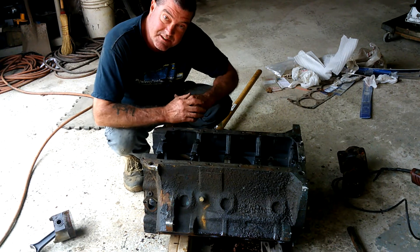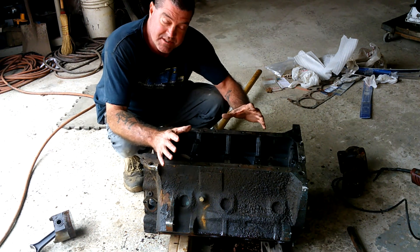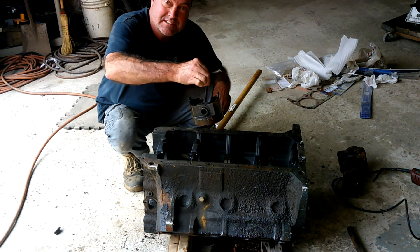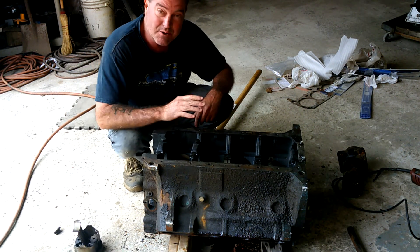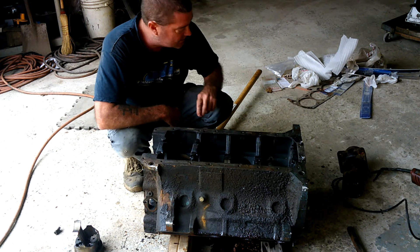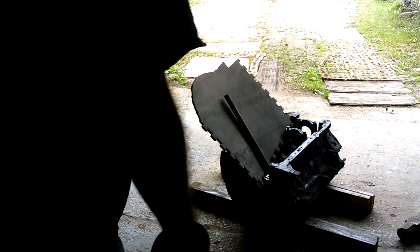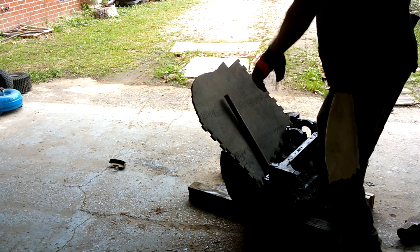You know how in movies right at the most climactic moment a commercial comes on? Well, something worse happened — my camera shut off right as that piston was coming out. I did get her out and here she is — I was like 'woohoo,' looked up and the camera was off. So we still got another one though, so I got the camera plugged in this time. Unless the power goes out we should be good. I'm going to have to find a different way to work through this rod and might try it with a piece of wood so we don't damage the block. We got this one out without incident and we're going for the other one now. I've got a two-and-a-half pound sledge and a bigger one if I need it.